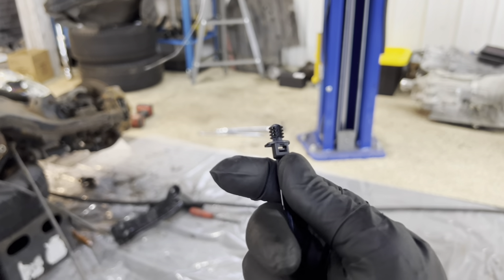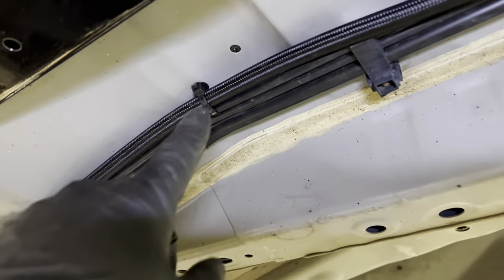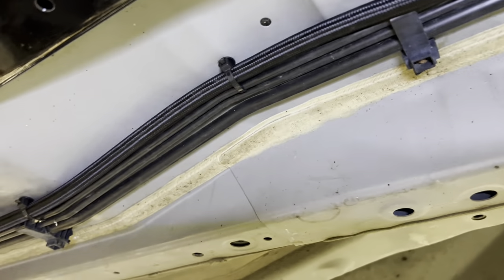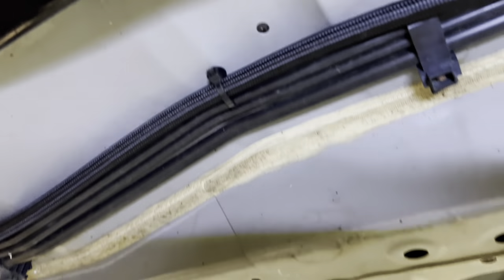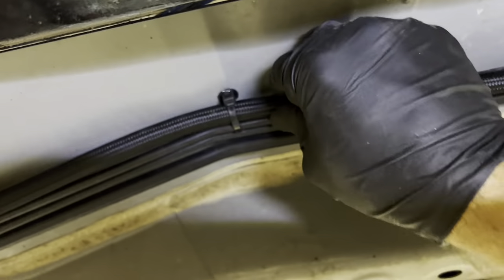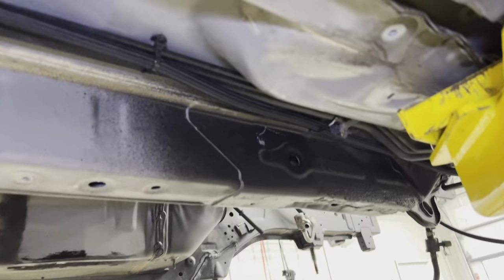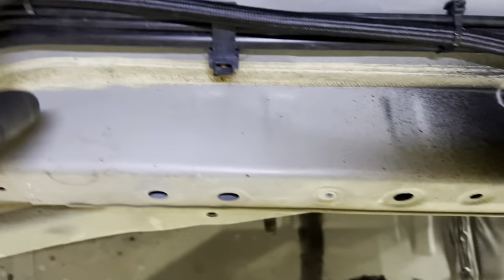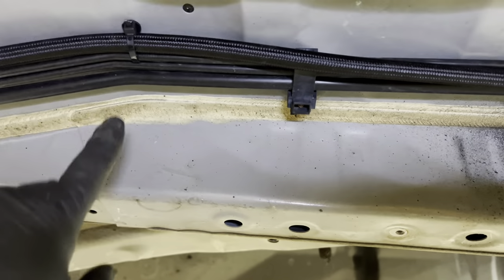Here's a tip: this is a zip tie that has a push-lock on it. What you do is you index your holes — you put the zip tie on, then drill a little hole through the chassis. It's super tiny, nothing dramatic sticks through. Then you zip tie the push-lock in there and it makes it completely locked — never going to come apart. That's my advice for those of you running fuel lines. Easiest way to do it by far, because if you ever need to remove the line you just snip it, pull the piece out, and push another piece back in.